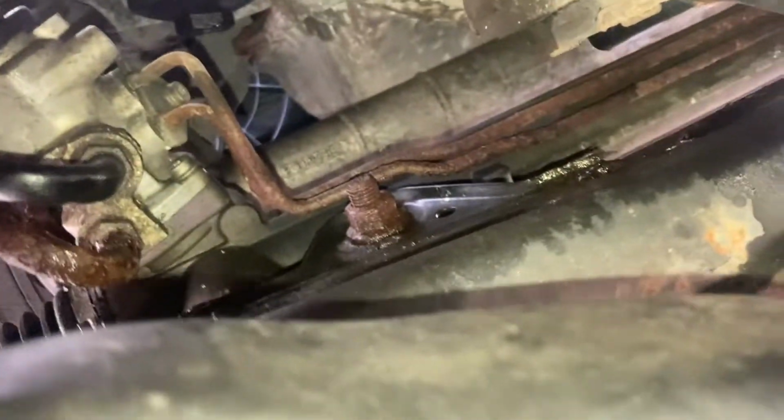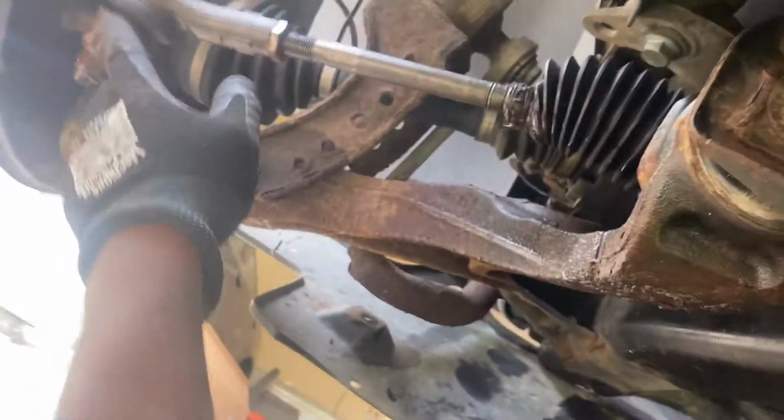And we have a 21 millimeter framing bolt, it actually bolts to the frame. You can see it comes up right here. Might want to put a socket on that side. That is an 18. Any corrections if I'm wrong while explaining this, I'll put a link down in the description or something of that nature. All right, so get that off. Like I said, you come over here, loosen up this framing bolt from the bottom. You're gonna have to put a wrench or socket right here, whatever you prefer.